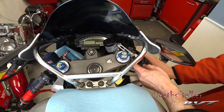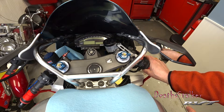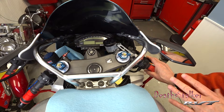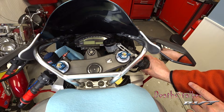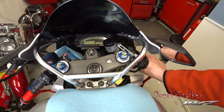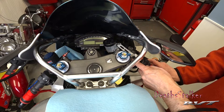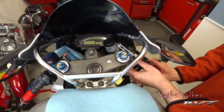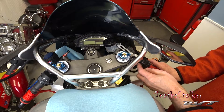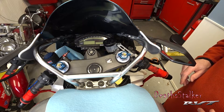In all reality, I actually want this brake lever more this way on the clip-on. Looking at where my fingers are for braking, I can't hold my hands down here and get a comfortable brake grip. I'd prefer to have it down this way a little bit so you have room for your thumb and you're not constantly jammed up against things. If I can get this down about this far, that might fix it. If not, the other option might be simply taking this switch off, pulling it in, and putting the switch into the side of it — since it's an electrical hookup, it doesn't really matter. So I'm going to pull things apart and change it and we'll see what happens.